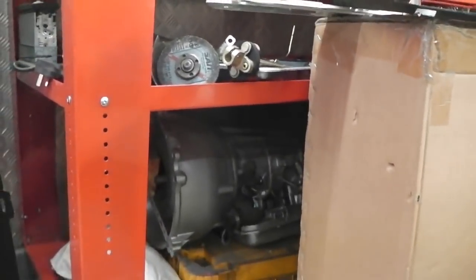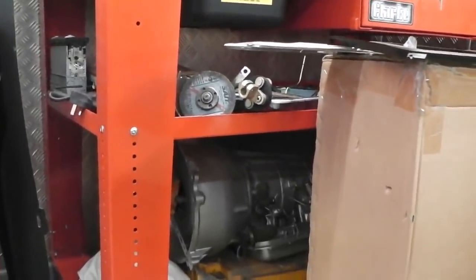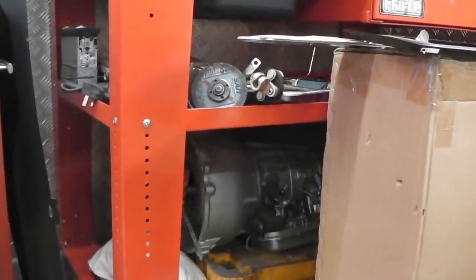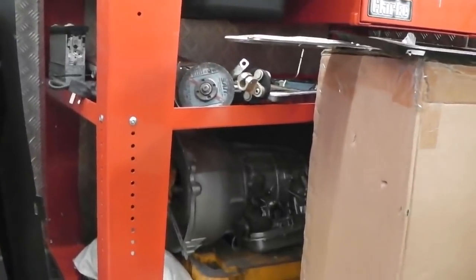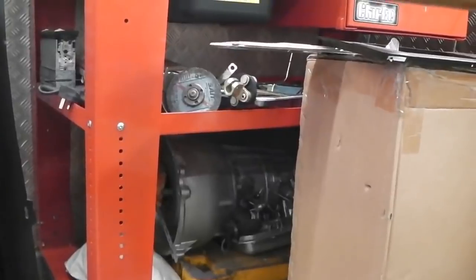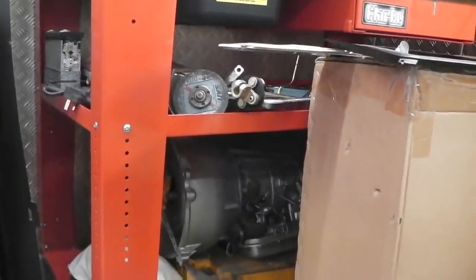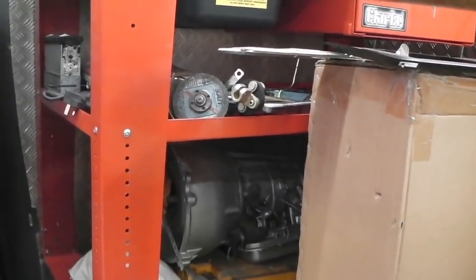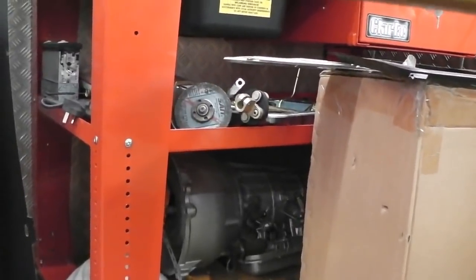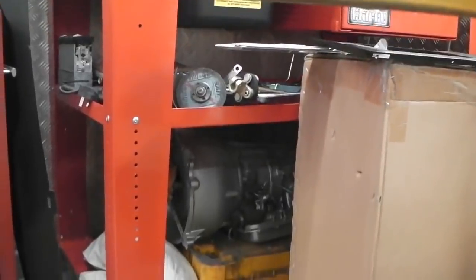It's electronic kickdown, so we need a micro switch on the end of our accelerator pedal to operate the kickdown, and a relay to control it as well, because it's twin coil kickdown. A heavy coil brings in most of the work, then a lighter loaded coil holds it in the kickdown position. That's to stop it getting too hot. If you use the main windings of the coil to hold the kick down in, it would get hot if you kept your foot down. So they have a secondary winding, much lighter. Once the main work's been done, when it pulls the kick down lever, it can hold with a much smaller holding current. So that's why they do it, stops it getting hot.